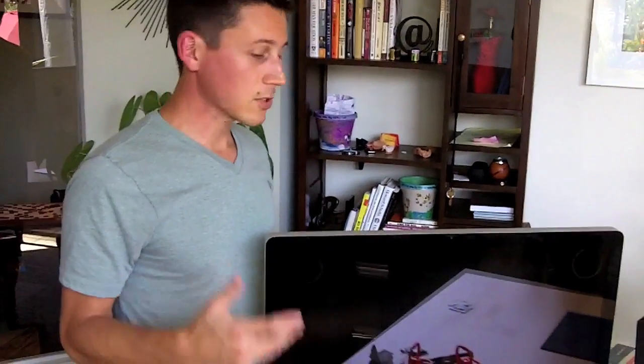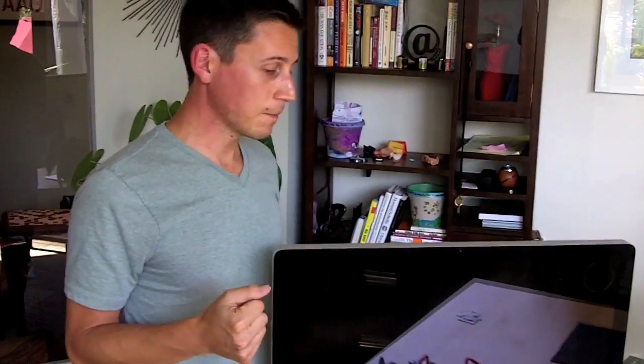So make sure you've got the right hard drive, get some suction cups, get some anti-static wipes, get your T8 and your T10 Torx driver, and your paper clip, maybe some needle nose, and you're good to go. In and out in probably 15 minutes.